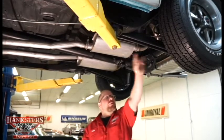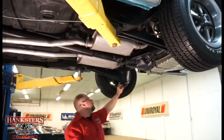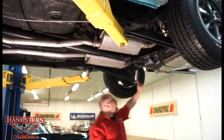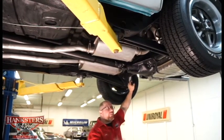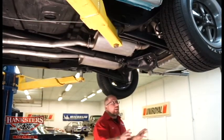As far as rear suspension, it's just your stock metric 4-link back here. So you've got your lower control arms, your upper control arms here too. All of your bushings and everything look to be in great shape on both tops and bottoms on the car. Again, shocks, same thing as up front. Looks like they've been swapped out fairly recently. Everything looks great. All the hardware looks brand new on them. So all that looks really good.